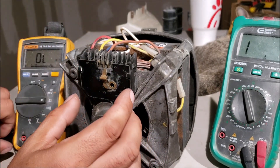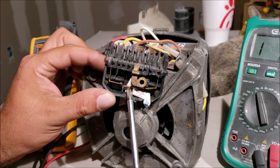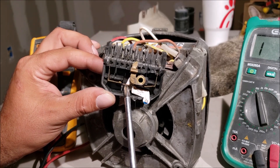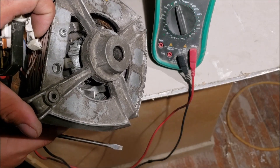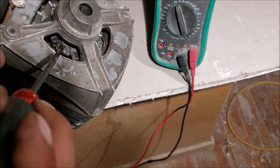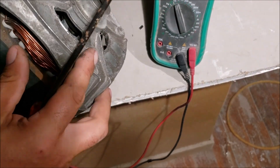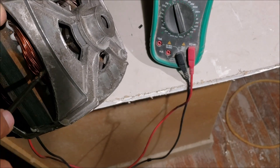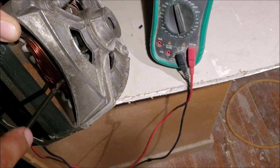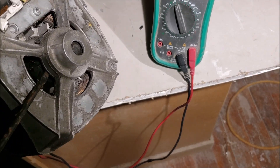It's just one screw holding the switch to the unit — take it out and it slides out. You can see how power comes in through the switch right here; it's got a little set of contact points, and then it goes over to the red wire. When the motor starts up and gets enough speed, centrifugal force combined with the counterweights is going to move this piece down, and you can see this little wheel — it goes down like that. So at normal speed, centrifugal force slings that little wheel out of the way. You need to make sure this is moving freely.